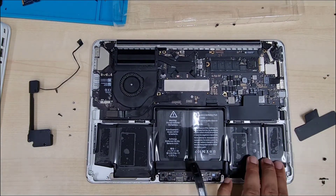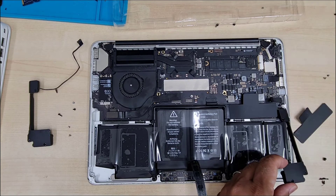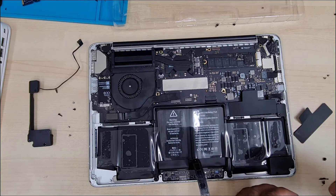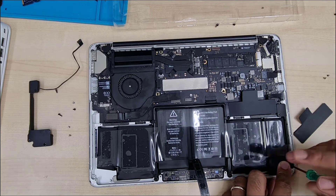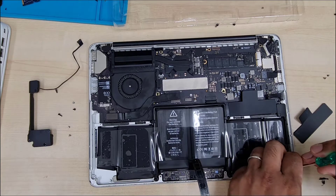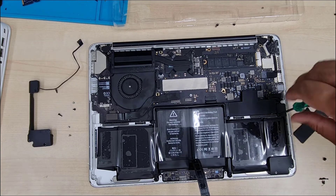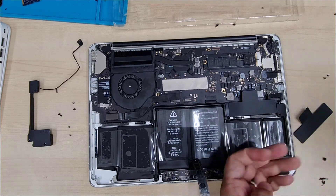We're not going to connect the battery yet — we're going to reconnect the right and left speakers first, along with the connectors and all three screws each. The shortest one goes at the corner, the second one is skinny but long — I put it in wrong and had to take it out and put in the correct one. The middle one is quite long and skinny, and the fat one goes on top. I made a mistake, so make sure you keep all the screws organized — that would be much better.